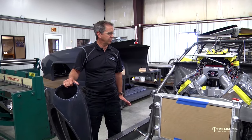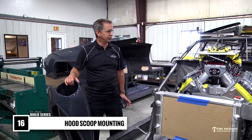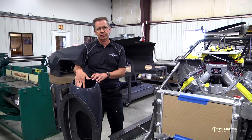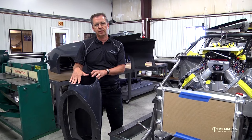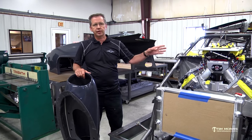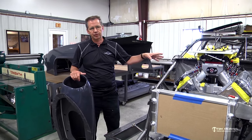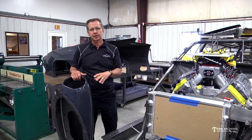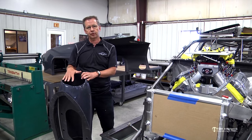We've got the front end mounted on the chassis and the next step is to fit the hood scoop. A couple of options: if you have the actual engine ready to go, you can put it in and that'll help you do the isolator tray at this point. If you don't have the engine ready yet, you can still fit the scoop because you need to do that before you send the car off to paint, but you can't really do the isolator tray. If you do it the other way, you're going to have to put the isolator tray in after the car's painted, so it's a little riskier working on the scoop after it's done.